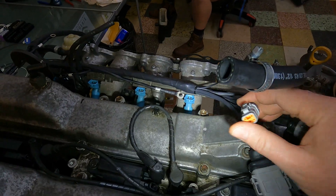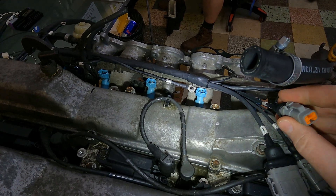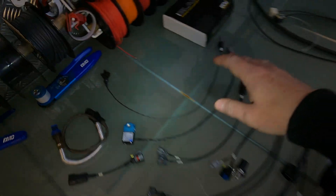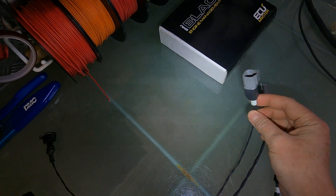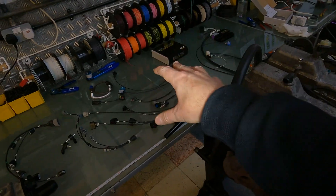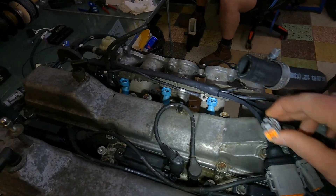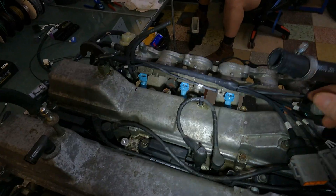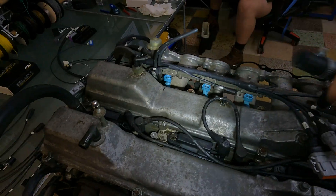This is a J61 plug in, so we have access to things like reverse lights - that's why we have this gearbox plug over here. This guy is having a BMW gearbox, so we've got a reverse light switch to plug directly in there. As you know, BMW gearboxes do not have a speed sensor on the gearbox. On the plug and play versions we do have a gearbox section, so when we do these for say an IS200 as you've seen in a previous video, we could put the speed sensor and the reverse light all in there.